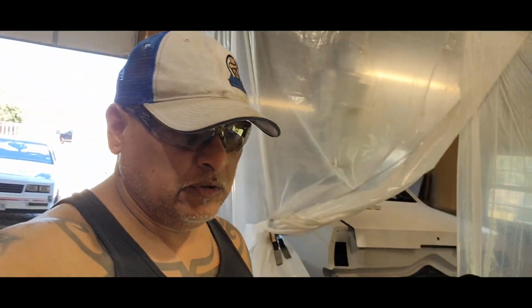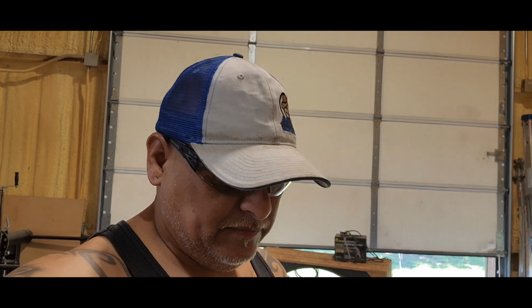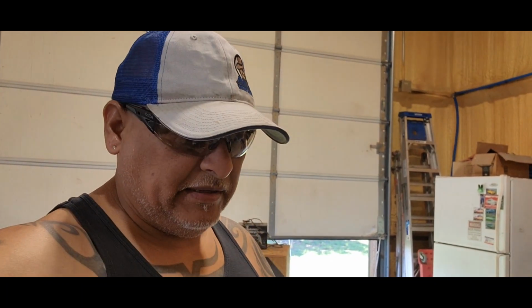Hey YouTube, we're back. Alright, so today we're gonna go ahead and get this block taped up and pretty much all masked off. There's a couple other spots that I need to clean some gasket areas off, but we're gonna go ahead and get all this situated, masked up, and then that way we can get the wire wheel on the drill, clean up the block, get all the old paint off, and then go ahead and get it in primer and then paint it today.